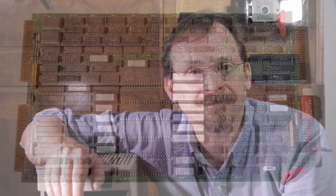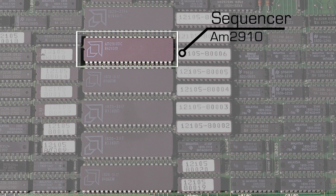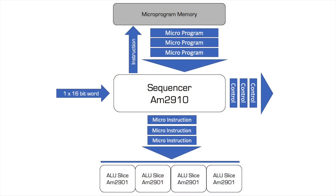You might wonder how you can implement a completely different system architecture, like a PDP-11 and this HP-1000, with the same basic chips. The answer is microcode. They are controlled by this chip, an AM2910, which is a microprogrammed sequencer, and these PROMs here are the microcode. The machine still supports the same basic instruction set used on the 2116, even though it's some 17 years on from that predecessor. It does it by mapping between control signals to relevant micro-instructions. Each assembler instruction becomes a little program run in microcode.